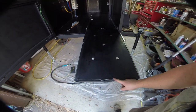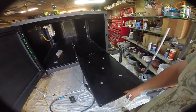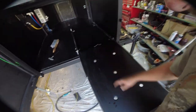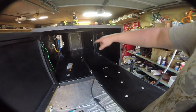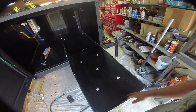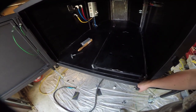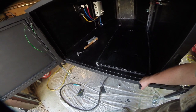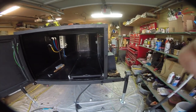Here's our final fridge shelf installed — one-hand operation in and out. I also welded these on both ends to secure the fridge to this chassis. It's pretty solid, doesn't seem to move too much. These were officially rated at 300 pounds, and I can sit on it, though the lever arm does flex a bit. Part of that is because I used individual mounts rather than a long bar, and the actual working weight will be less than 150 pounds, so I think it'll be just fine. There's about a quarter to half an inch of clearance down here — if it rattles against the door I'll install little foam bumpers to take care of any rattling issues.